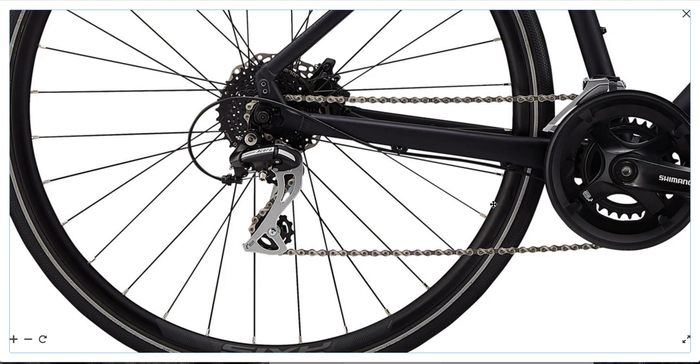And it doesn't really compromise much. On a triple drivetrain there are a lot of gears that are duplicates of other gears, and you're also constantly spinning two more chain rings that you're not using. Another note about the cassette: it's Shimano but their most basic cassette — a painted cassette, not chromed or plated in any way, so they're susceptible to rust. If you're near the ocean, commute in any weather, or leave your bike outside for long periods, you may want to spray it with oil. I'll leave a link in the description for a really good corrosion protection spray — it's also a lubricant used by Boeing, which is pretty cool. You can also use it on your chain and other components.